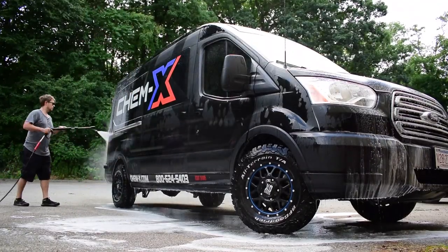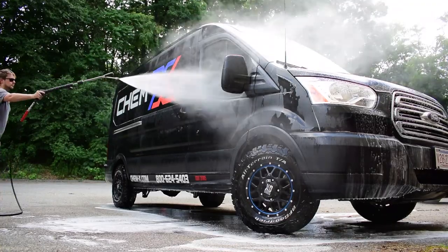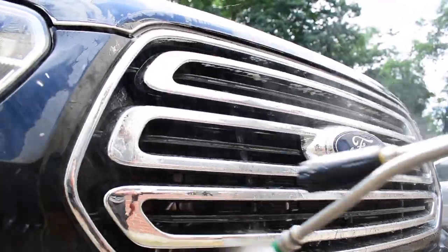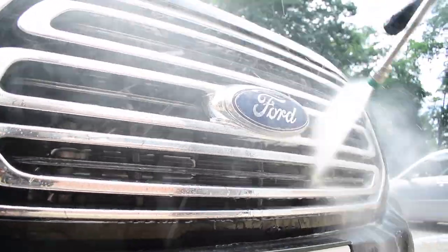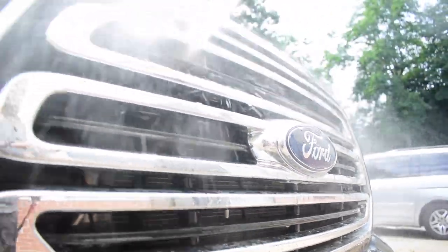Maybe I'm crazy. The final rinse is top down though, and you could just go top down if that's a preference and save a little bit of time, but the rinse is very important — it's like half the whole wash. On the forward-facing stuff, make sure you get real close. You're gonna want to be able to get the bugs off and the really baked-on road film, especially on a big rig like on the front of Stats.